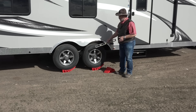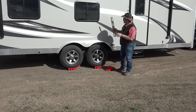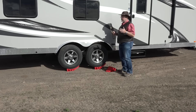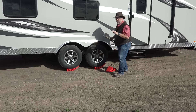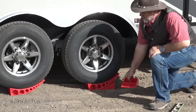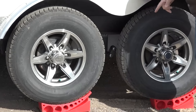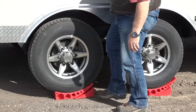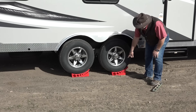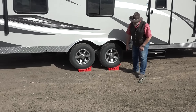You can see how we drove over the Camper Levelers from Anderson Hitches. That's the highest leveling right there. You can trim some of these if you need to, but then the wedges — after you use your level, basically have somebody driving the truck while you're running the level. You'll back up until you get the trailer level, so you don't have to do really one side of the trailer. Now that you've got that where you want it, these wedges that come with it, all you do is shove them under there to where it's tight. And that's all there is to it.